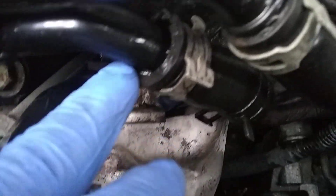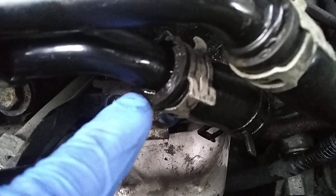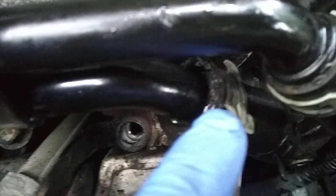Main concern is that when I was taking things off, I told the gentleman, this system is probably corroded — we should change all these lines. But of course, it had already become a very expensive job and I'm doing it as efficiently as I can to save him money and also still turn a profit. This hose on the bottom of that inlet cracked, so what I did is move the hose up and move the clamp right where it would be. I'm verifying because it also doesn't have a bolt where the thermostat housing is at, to verify that it is still holding pressure. And as you can see, we are still at 15 pounds.